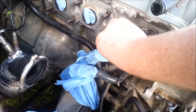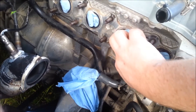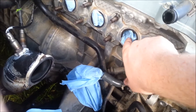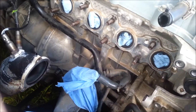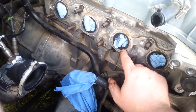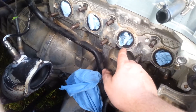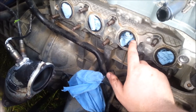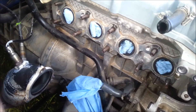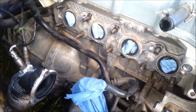So I'm going to have to look to see if they've got staggered valve timing — whether the valves go down at the same time or if one opens and then the other — because that changes the flow characteristics of everything past your cylinder head. For those doing machine work on their cylinder head, see this little dark ring? You can port to that ring, increasing it by about a quarter of an inch, which is quite a bit more flow out of the head. I'll have to do some maths to figure out exactly what that is.